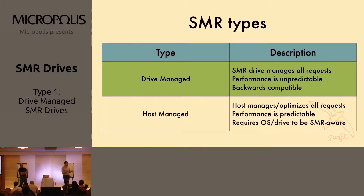Drive-managed does something very interesting. A drive-managed SMR drive pretends — it just kind of fakes it out and says you can use it exactly like you've always been doing. Just plug it in as a replacement for a PMR drive and you're not going to even notice. Your applications will still work, you don't have to do anything, and the firmware on the hard drive itself manages any sort of translation. If you write that byte, it's going to do all of the right things.